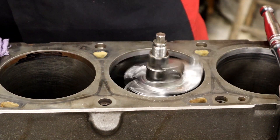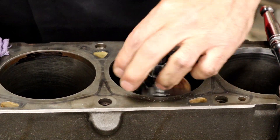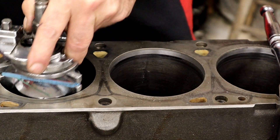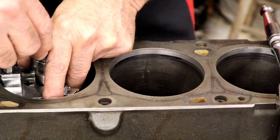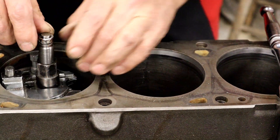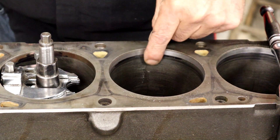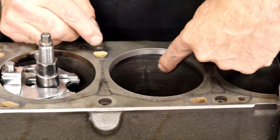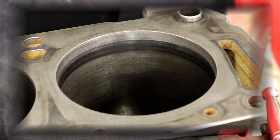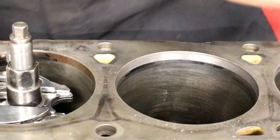We're going to bring that back down. Look at this tool — it's older than I am. I've had it since I was a kid. There's a slot for your finger. Grab it, move it to the next cylinder, set your height. You turn this and it expands the fingers, just like the Iskenderian tool did. Bring the cutter out. You can see the shiny area — I just cut the ridge and didn't cut the bore at all.